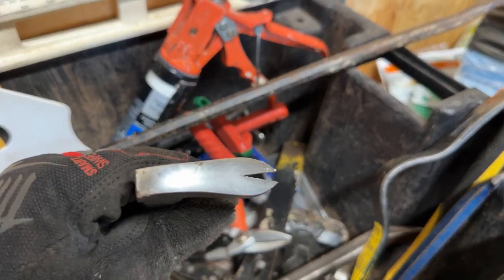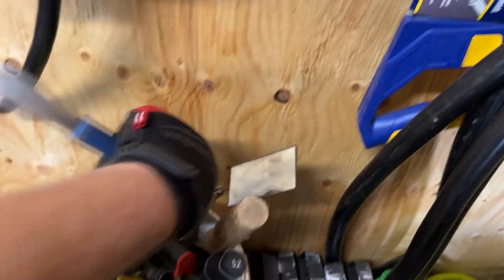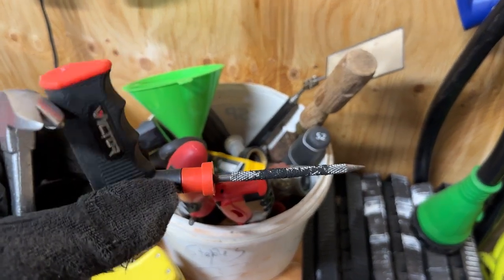This will work perfect. So once I pull that nail out, I'm going to want to plug the hole quickly. When the nail's out, I don't want to be looking for all my tools, so I'll need a reamer to make the hole a little bit bigger, and then I'll need my plugs and the plug injector tool. I'll dig those out now and get them handy. There's the plugs, and that's the reaming tool.